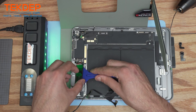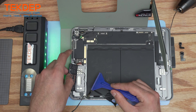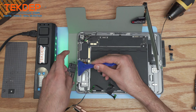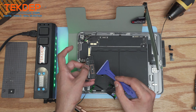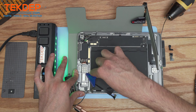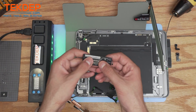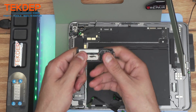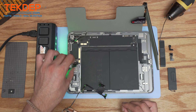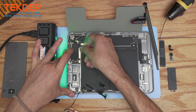This bracket sometimes stays stuck but it's completely fine — all you need to do is remove it by itself and it reattaches automatically. There is a magnet just below the loudspeaker so it just snaps back on. Next, we're going to start removing the logic board, so we're going to be using a plastic card.